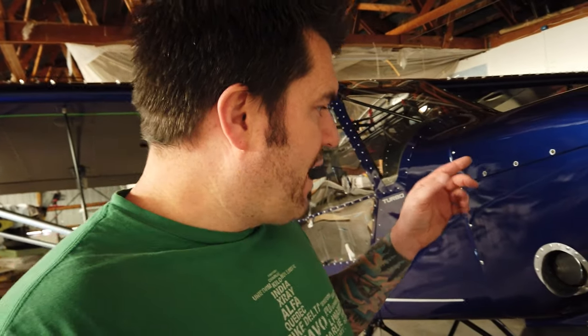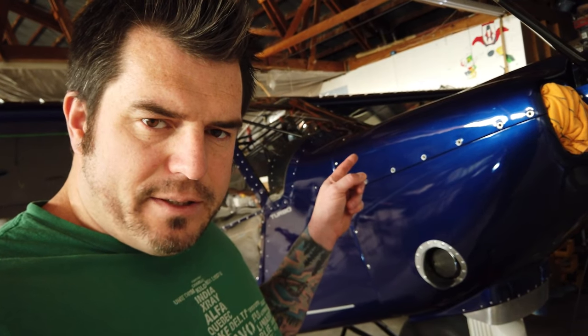It's kind of one of those deals where eventually you get to too much, and on the Rotax engine I'm not exactly sure where that point is — it could be fear of blowing up the oil filter itself. In my case on this Edge engine, I have oil squirters and those eat up quite a bit of oil because you're spraying oil on those pistons to cool them, and it's turboed, so you're feeding oil to that. The oil demand is pretty high, higher than it ever was from the factory since it didn't have oil squirters. That's the thought process behind this oil pump — we need more oil to do the job with those oil squirters.